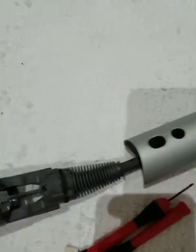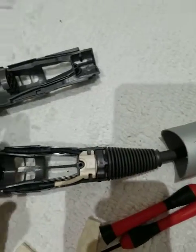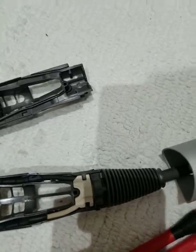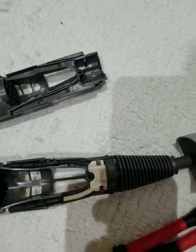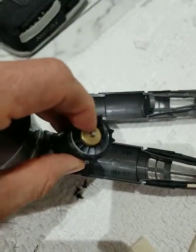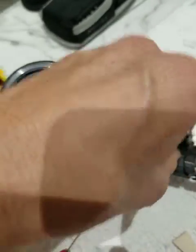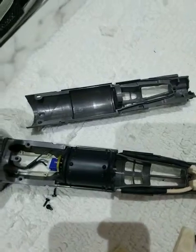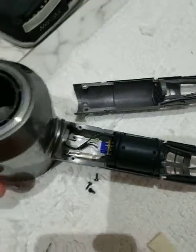There will be another rubber band that sits across the middle and you'll put that back in place when you're ready. After popping out the three screws and removing the housing, right away you have the motor — and immediately I noticed my motor was seized up. All I did was take my finger and spin it around a couple of times, and it completely unseized itself in a minute. I plugged it back in and as soon as I plugged it back in, it works perfectly fine.